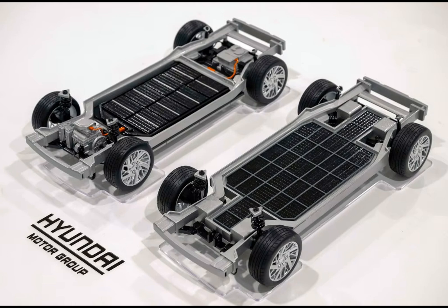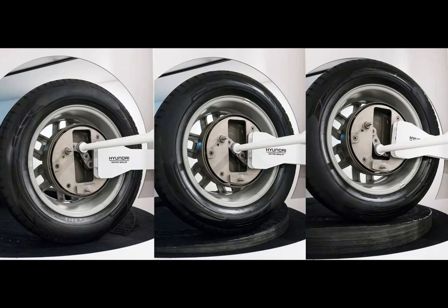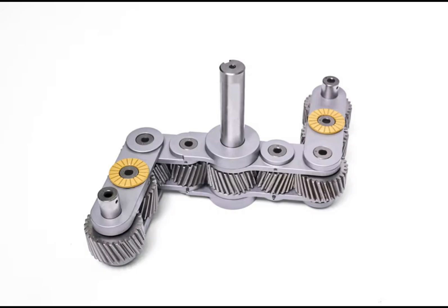To make the uni-wheel work, individual electric motors are placed near the uni-wheel assembly, necessitating two motors per axle. This approach eliminates the unsprung weight that comes with in-wheel motors while freeing up valuable space in the center of the vehicle. While this sounds promising, it raises questions about where other crucial components like controllers, inverters, and onboard chargers will be located. The relocation of the motors may not necessarily mean a reduction in overall complexity.